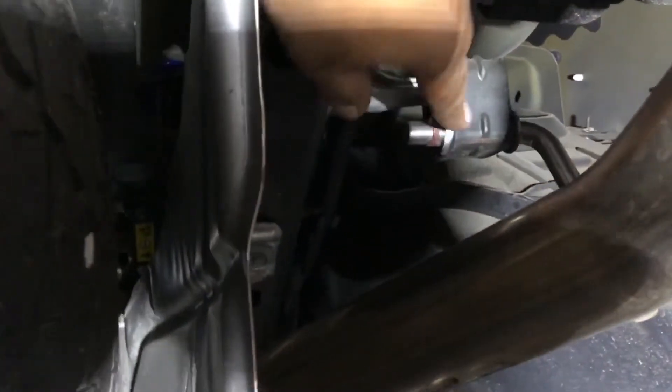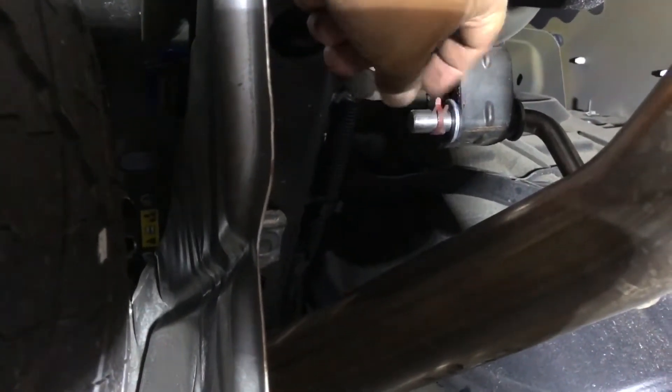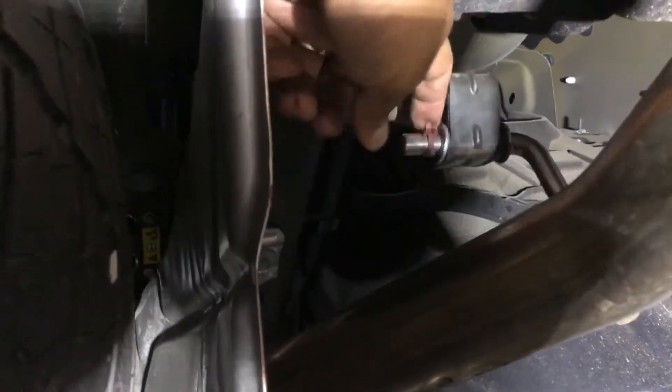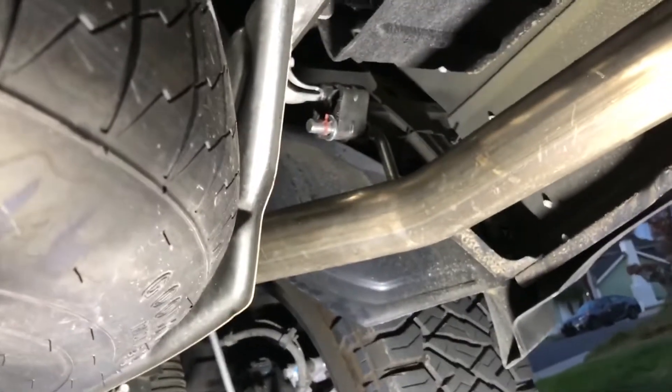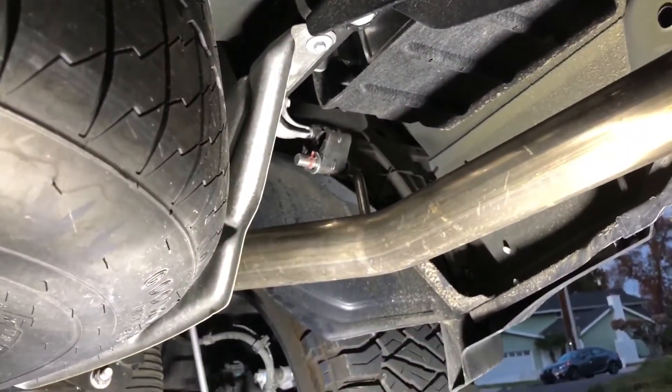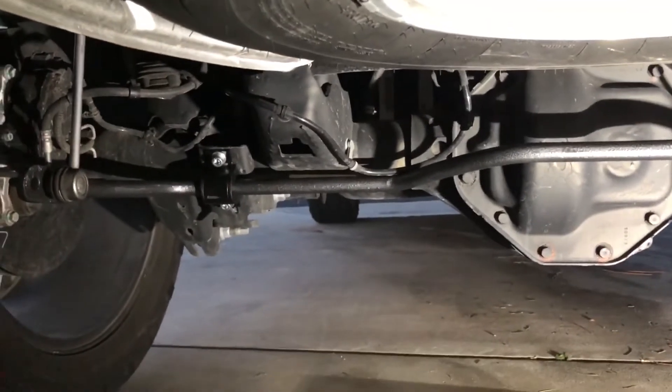While I was down here I also found out why my exhaust is making some sounds. Seems like the hangers that the exhaust company or the muffler shop put on there have worked their way loose, and on the other side it's completely slid out. That's good to know because the exhaust started rattling and has actually shifted its center over — makes sense that the hanger slid over, which is why the tip has shifted. I'm going to have to go to an exhaust muffler shop to get this popped back in, or on the other side I can just pinch the clip and slide it so the washer isn't rattling.